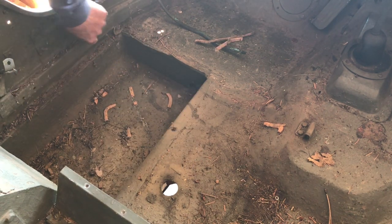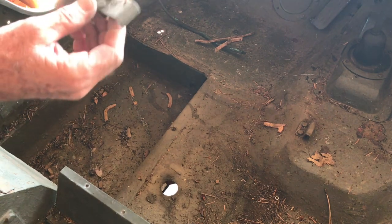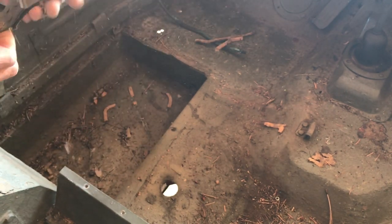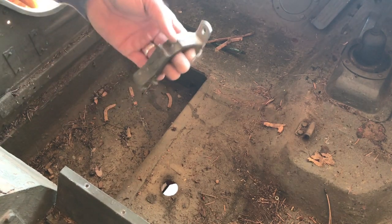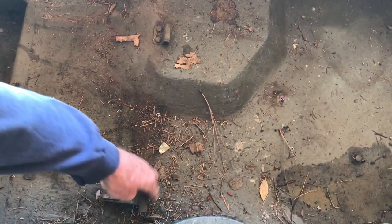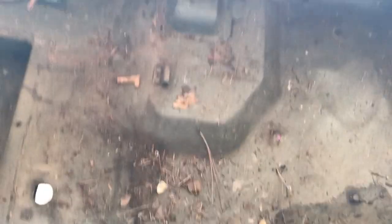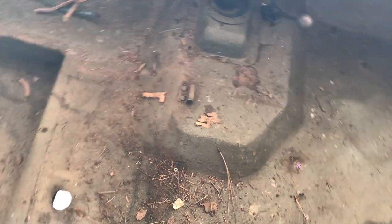You've got these hooks on the side here where your axe and shovel mounts are. All that piece does is hook onto that bracket like so, and then where we took the bolt off. I'm going to pair these back up with the same straps. Now if you look down here on the floor, you'll see another bracket where your strap hooks go, and then you've got this bolt-on one up here on the hump where the second strap connects. That's how the gas tank is fastened into your tub.